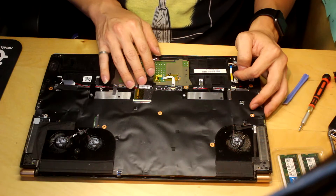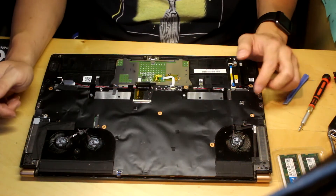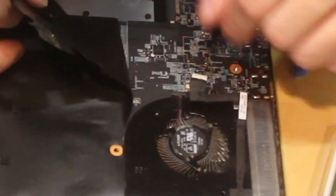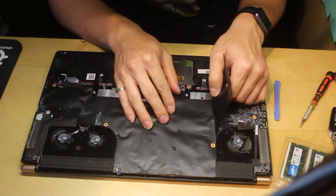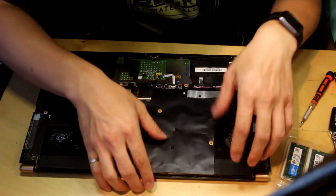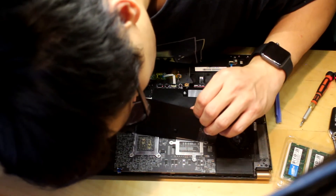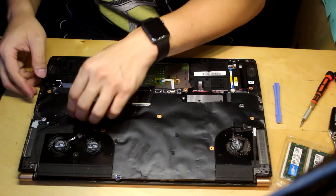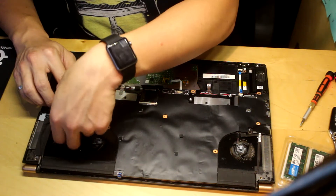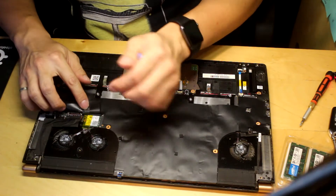Let's diagnose what we need to do next. We've got six screws at the bottom and one at the top. Next we have to peel off the shroud itself and discover any other screws. It just comes right off. It looks like an antenna of some kind. Let's check for any screws down here — no screws here. This ribbon here seems like the display connector for the monitor, so let's take that off.